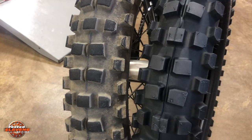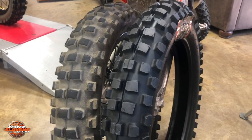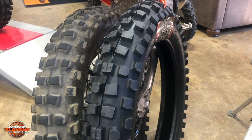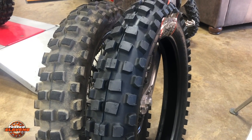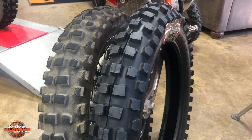There's one on the left that's got some miles on it, a new one in the middle. This tire does have the tallest profile of the three, so it's going to raise the back end up — could make it steer better, could make it steer worse. You might have to adjust the preload just a hair to compensate for that, but usually not.